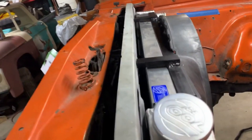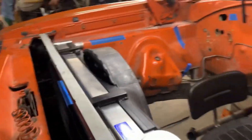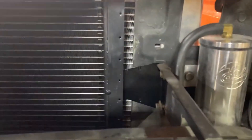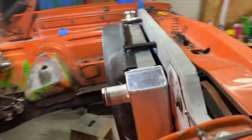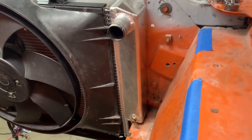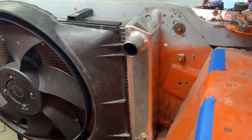There's a body stiffening rib that's holding the radiator away a little further, and I don't think there's much you'll be able to do about it. We did get the condenser installed — I like it, I think it's going to be fine, though it takes up a lot of that space. Hopefully that'll make for some really nice cool cruising. There's the lower section I'm going to run out into the inner fender, and the upper lines will run along the top of the inner fender and go back to their correct hardware. There's the passenger side view of the Be Cool install — a little more room on this side.